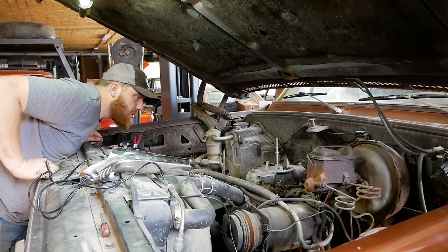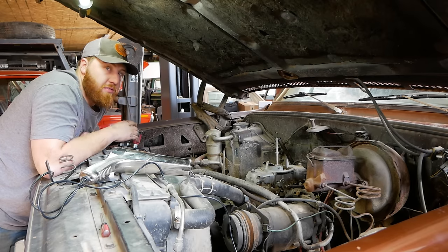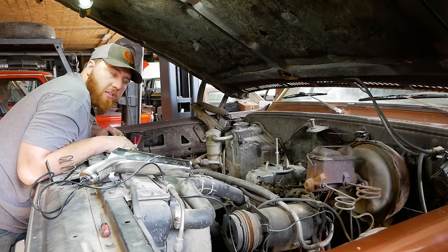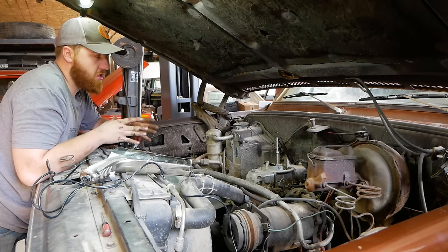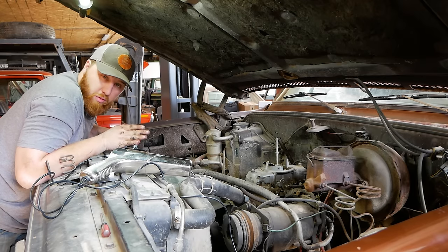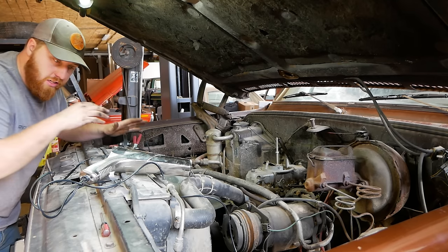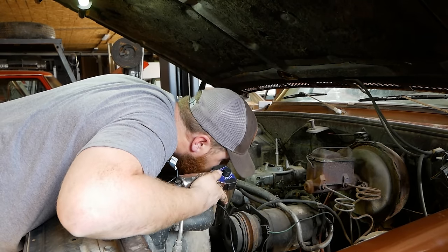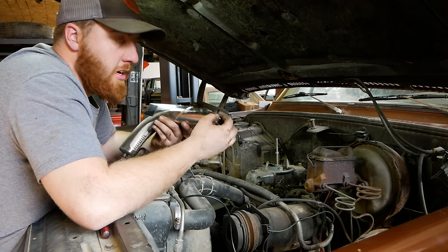Put the clamps on your positive and negative battery terminals respectively, then loosen your distributor bolt so you can turn it back and forth. If your engine's been sitting a long time — especially if there's coolant near the distributor shaft — it may be frozen and need some PB Blaster and light tapping with a dead blow to get it moving. Every time the timing gun senses a spark on that number one plug wire, it flashes a bulb — that mark we made will be coming past the timing tab acting as a strobe light.